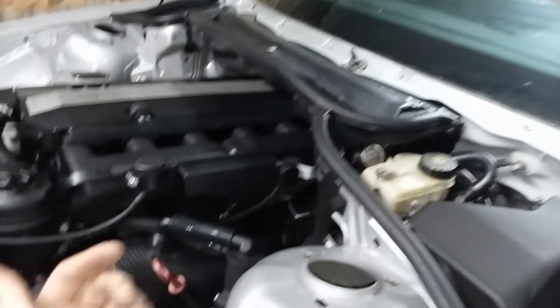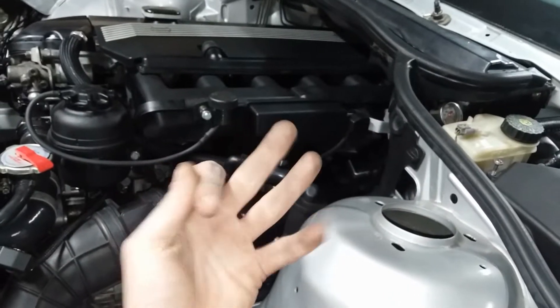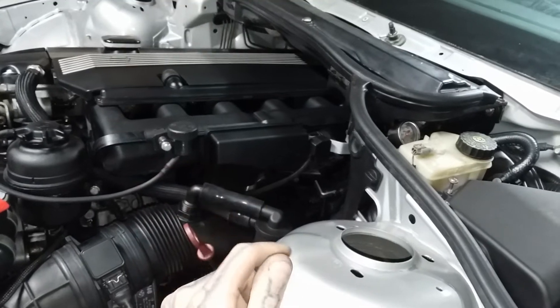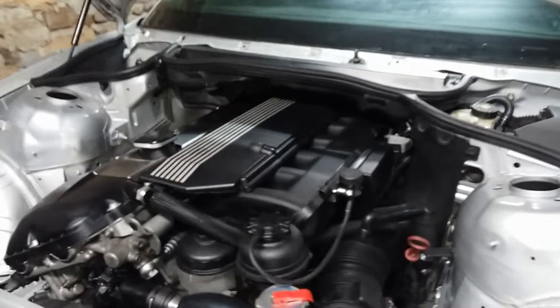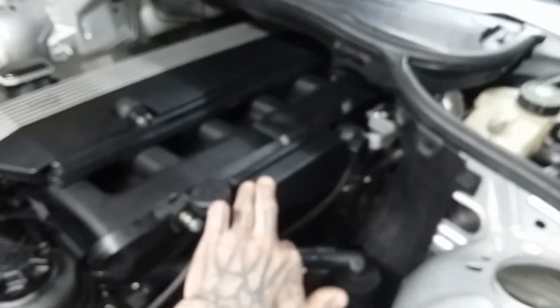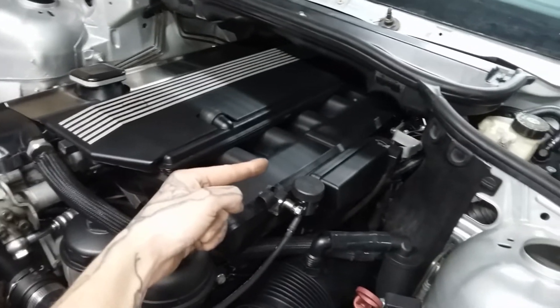We also have a fuel cell in the trunk, which was shown in previous videos. I have three parts to the fuel system, using a 17-gallon fuel cell back there — it'll also be full AN leaving there with an inline fuel pump. We're also retaining the OEM DISA valve for even runner distribution through the RPM ranges.